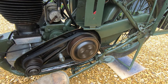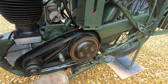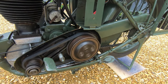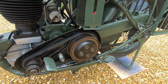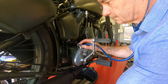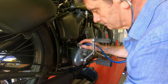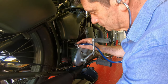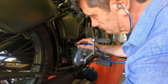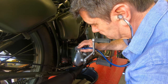The noise also happens out of gear. I've taken the chain case off to investigate because my first thought was either the clutch was slipping or maybe the primary chain was rubbing on the chain case, neither of which turned out to be the cause. I also used a stethoscope to check for obvious noises from a pinpoint location or anything preventing the wheel turning freely in neutral, neither of which turned out to be the case. So really there's no option — we've got to get the gearbox out and have a look inside.